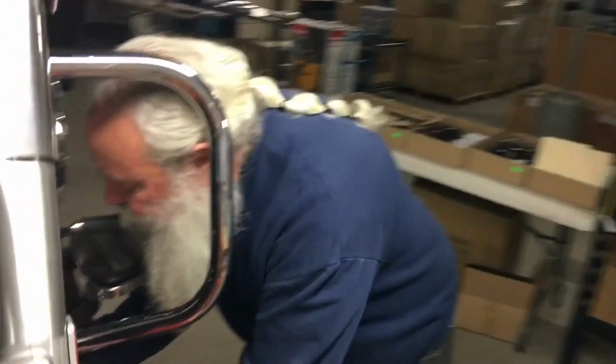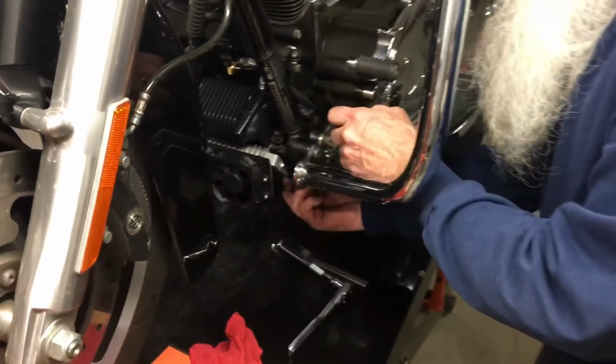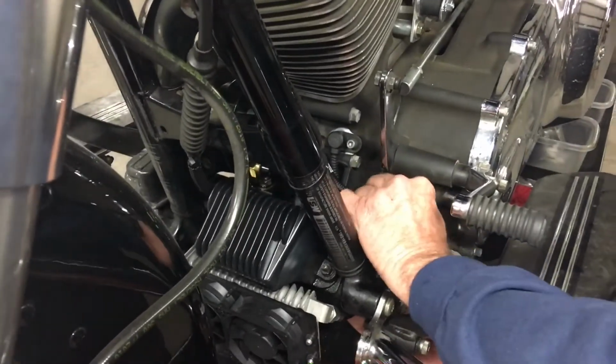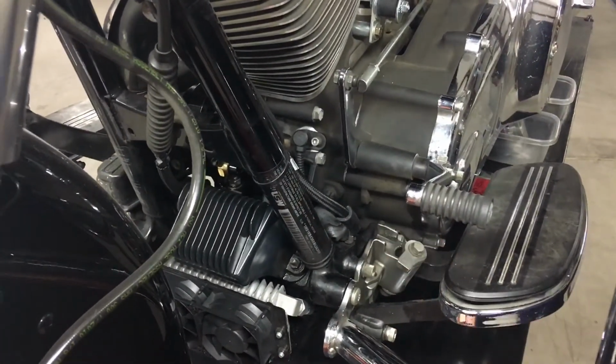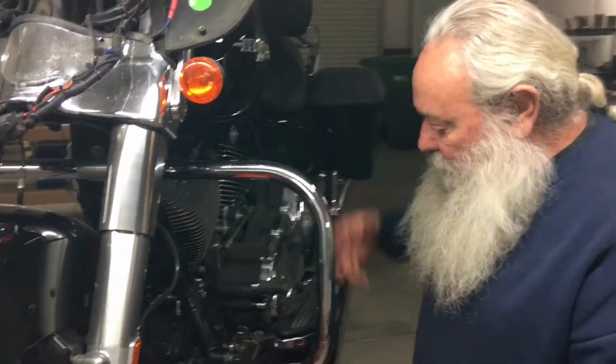Check to see if your hoses are rubbing anywhere. And if they are, like this is hitting the motor mount right there. So I'm going to put this down here, just like that. Now, it's a rubber against the motor mount. I'd put a tie wrap on that to hold it in place, and your hoses are done.